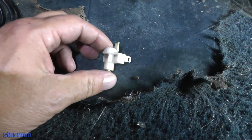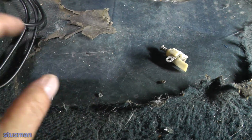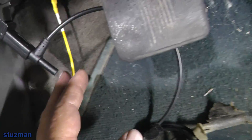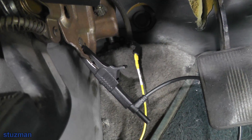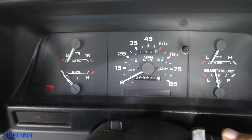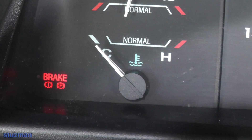Here's the switch - a broken switch. I've disconnected it, and what we have now is I've taken the connector and plugged in a test lead. The other end is connected to this bracket for the parking brake mechanism so I can get a ground. Let's take a look and see if that does anything - see if this light bulb will come on. Okay, let's turn it on - and as you can see, it does come on.